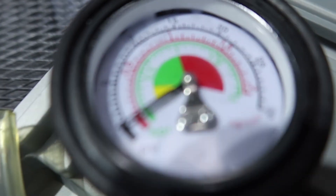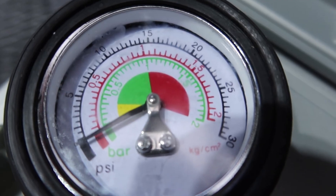My metering lever is pretty much factory height, but I've changed to a different spring. My pop-off spring resets at the correct 10 PSI — it doesn't go below 10, it stays between 10 and 12 PSI — but it does pop off between 16 and 18 PSI. So I've got a much higher pop-off pressure, which leans it out a little bit more. That's why I've left my top jet factory and opened up my low end. Combined with the disc modification, this has smoothed out the fuel-air mixture right through the range. I now have a much more reliable RPM — some flights it creeps up slightly then brings itself back, but most of the time it stays pretty much where I set it. It's been a joy to fly.